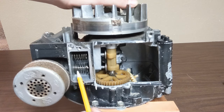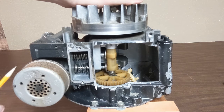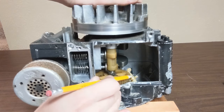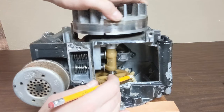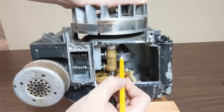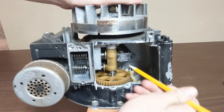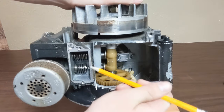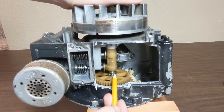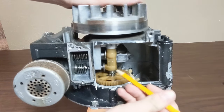Here are the two valve springs. Those make the valves go back to their seated or closed position on the front side of the engine — we'll take a look at that in just a moment. Right here we have the oil slinger, and this is what makes the oil move around in the engine. It's basically a paddle wheel for the oil, which gets oil onto the crankshaft and connecting rod connection. It also slings oil all the way into the back side of the cylinder to lubricate the piston, onto the camshaft to lubricate the tappets and the lobes, and also lubricates the gears as they're spinning.